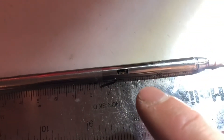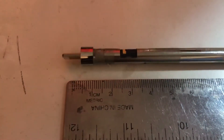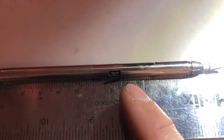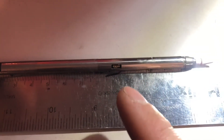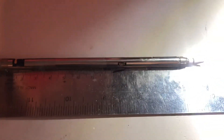So roughly 98 millimeters from the flat edge gets you smack bang in the middle of the hole. If you measure from the very flat edge down the side of the connector and cut that piece of plastic away, you'll get access to that hole. With the CE markings facing you, roll it forwards and the hole will be down there — draw a line, mark about 98 millimeters, and cut a rectangle out to access the hole. Once you have access: the pin at the far end closest to the nib is ground (negative); the second pin away from the nib is the battery power pin — that's where I put 4.2 volts in and it charged the battery back up. Unfortunately it didn't fix this particular pencil, but hopefully it will help someone else fix theirs.